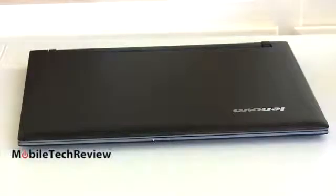If we leave auto brightness on, and you know, it's not terribly bright at that, but I know some of you can tolerate dimness pretty well. But with auto brightness on, Wi-Fi on and active, we have managed to reach 8 hours with this. So as an all-day companion to go to school with or to take to work without being plugged into AC, that's pretty darn good. It helps that it has those ULV CPUs instead of full mobile CPUs that you might also find in a 14 or 15-inch machine, because those consume more power and they also make more heat.